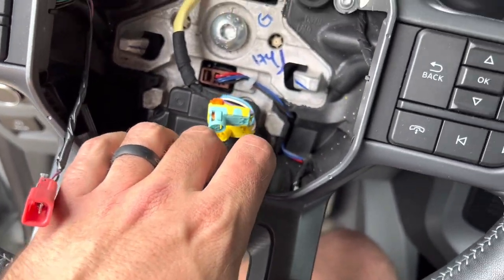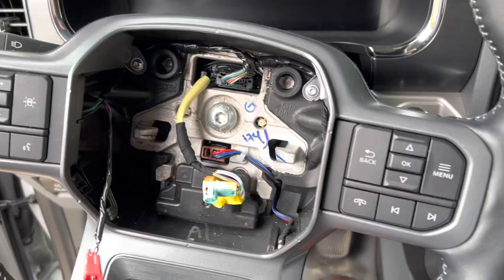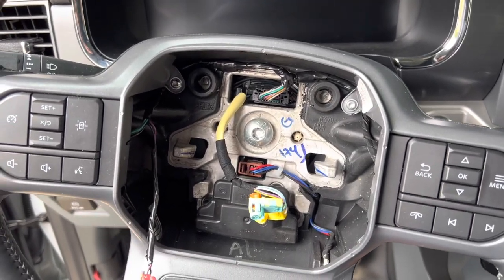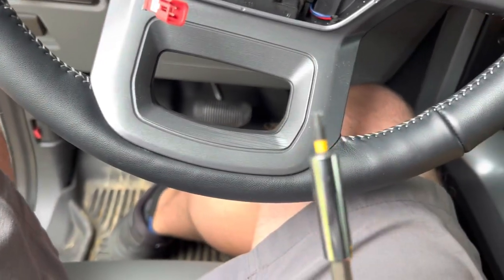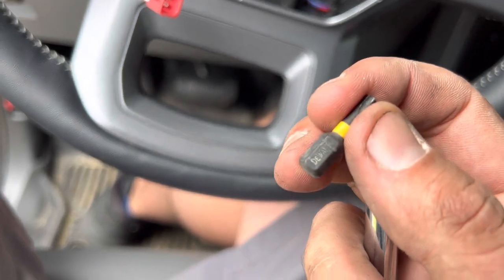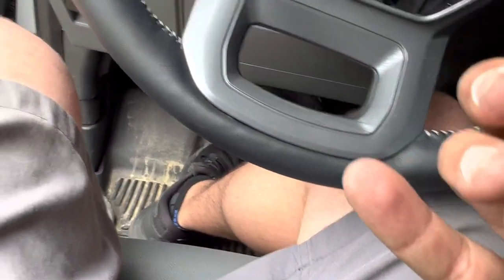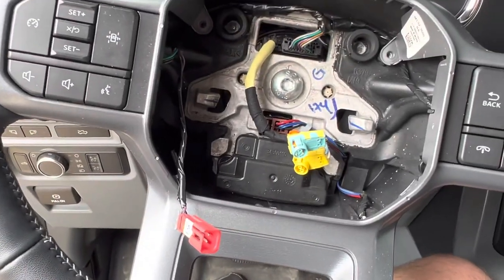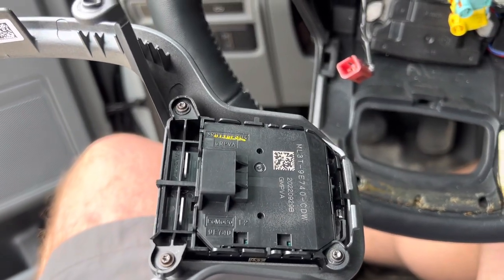I did this before — I have a leather steering wheel on my Pro that I swapped in a few months back, so you can check that video in my profile. We'll get these out and pull the buttons out. I was actually able to get my impact on there with a T20 torque bit. Put your hands down here and slowly work these pins away and pull this away. There are two plugs you need to unhook on these sides. Just unzip these on both sides and we can pull these right off and put the new buttons on.